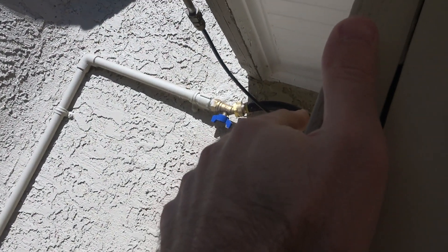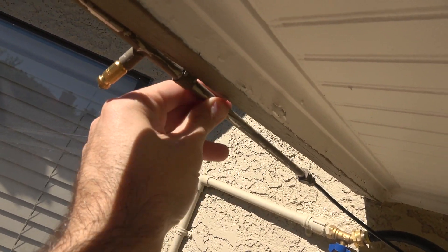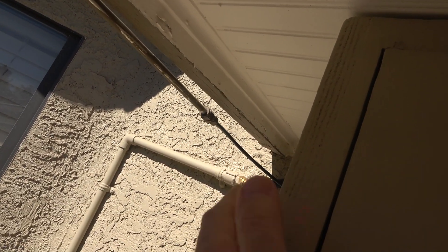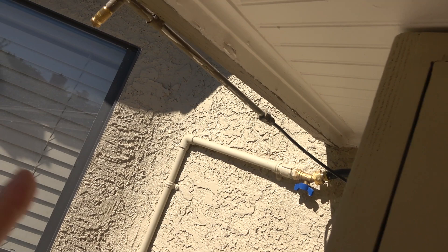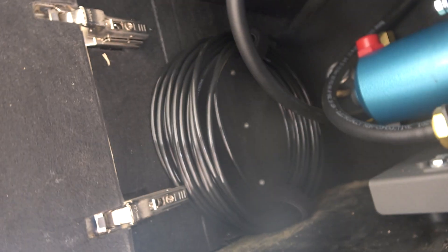When you get to these areas where the tubing is constrained, the tube can't move. This hard line tube — it's attached to the roof, it's hard, it doesn't want to move. It's not going to vibrate because by this point the water is going to be flowing smoothly. So where it goes into the tube, you can think it's kind of pulsing, and then by the time it gets to the end, it's much more smooth because all the water in that line is dampening those vibrations.